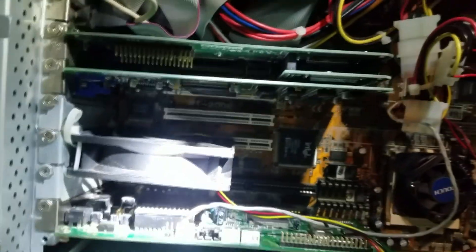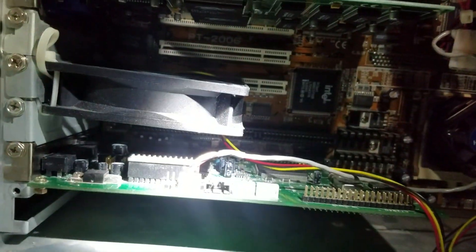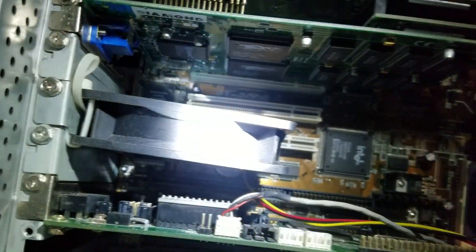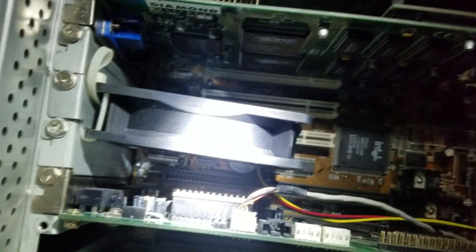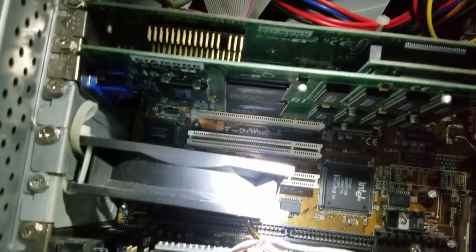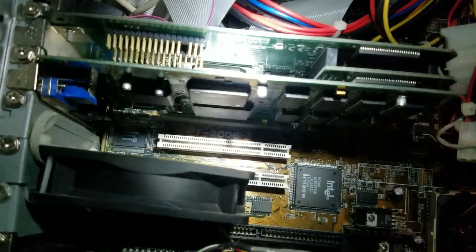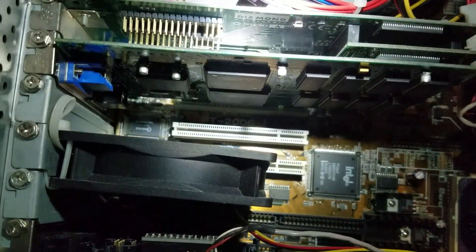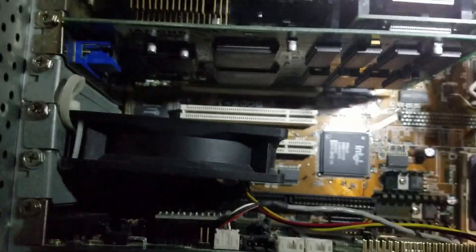So here's my Pentium system. Before we get to the video cards, I just want to point out my sound card — this is just the Sound Blaster 16 with the Dream Blaster daughterboard. I've got a fan here for the Voodoo card; the Voodoo card runs kind of hot. It's not like the Voodoo 3, but it does run pretty toasty. I threw in a fan wrapped up to a PCI bracket and it does a good job of knocking off some heat. Above that is my 2D video card — that's an S3 Verge. I picked it because I really like DOS games and it has really good DOS compatibility. The S3 Verge is the one I mentioned earlier which had really bad 3D, which is why I have the Voodoo in there alongside it.